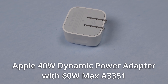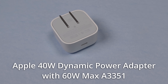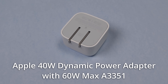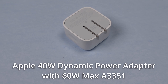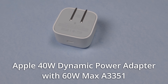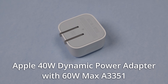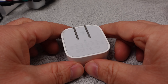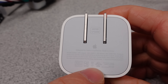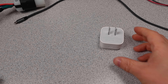Conclusion time. Is this the ultimate single port USB travel adapter? It's all opinion. It meets all the specifications and requirements that can be asked of it — it can charge your laptop, it can charge your phone, it can charge all your USB-C devices, as long as they don't need PPS or anything other than USB-PD. That's the limitation with this charger. It has a little less compatibility than some other chargers on the market because it chose to support the latest technology and not any older communication protocols. It's really nitpicking though — it's a good charger and it's ready for the future. I think using it in the home setting is not the greatest idea, especially if you're going to be using multiple of them. For Apple phones, this is the one that will get that job done. I can see using this adapter as a travel companion since it's light and small — maybe throw it in my cycling kit as an emergency charger since it can go fast.